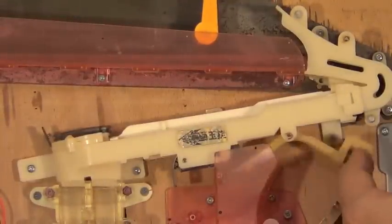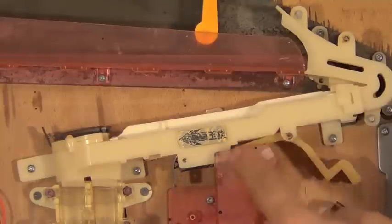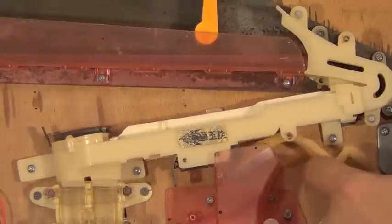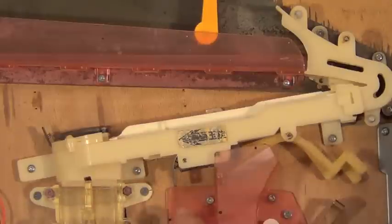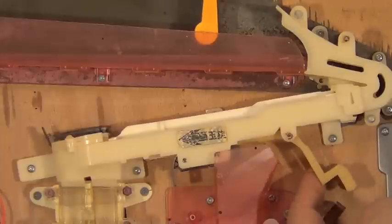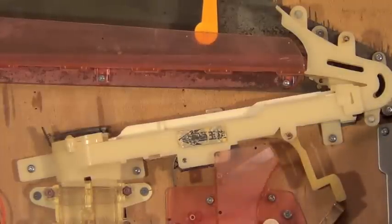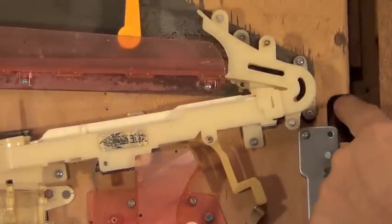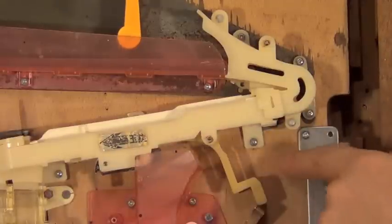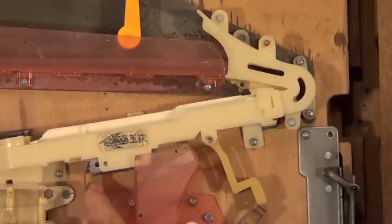We've got a couple of levers here. These two levers are right now in the open position, meaning balls will fall through and empty out of your machine. This is the ball drain lever. So in normal play you need to have those levers locked — lock them by pushing that lever over to the left. On some machines you'll have a small metal part with a wire that runs across the front or back by the wood, and you can pivot that wire to do the same thing.